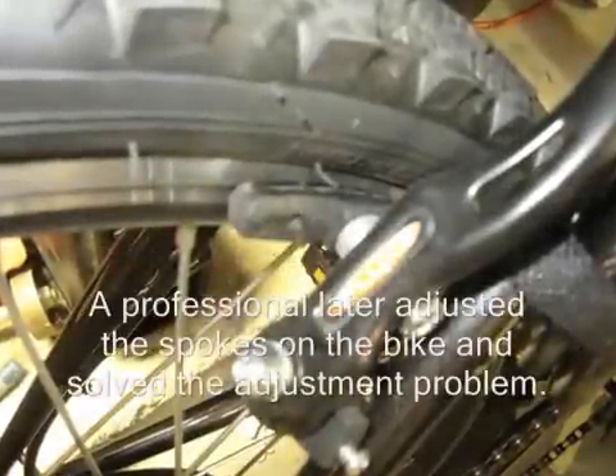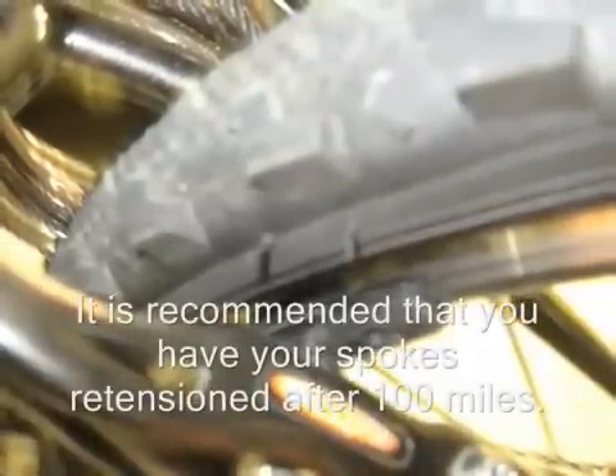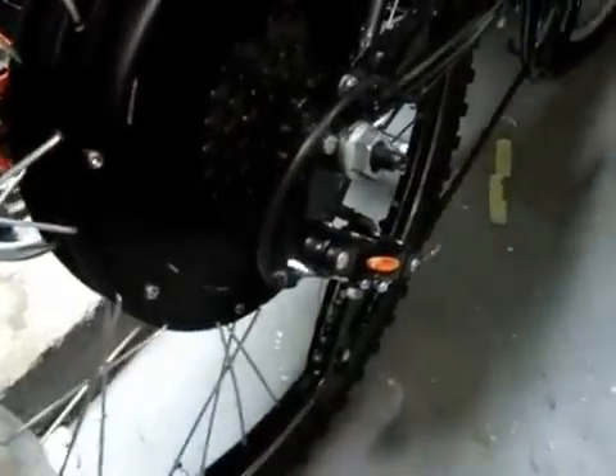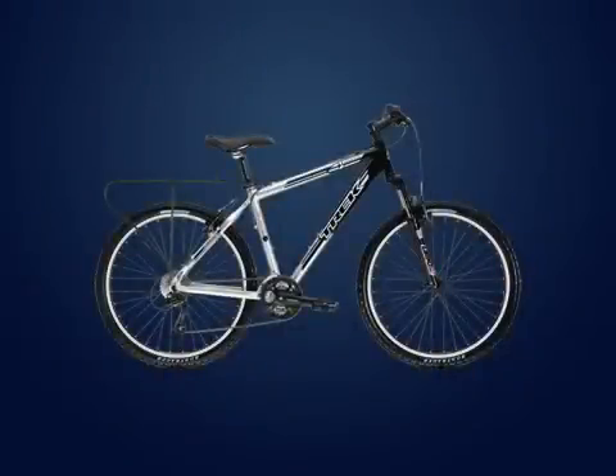With the new tire and rear wheel installed, I also had some adjustments to make. The right brake pad lined up well with the tire, but the left brake pad was crooked, so I had to bend the screw post to make it line up properly. Also, we started with a 7-gear wheel and replaced it with a 6-gear wheel, so we need to adjust the derailleur on the back so the chain won't slide off the final gear. You might even want to take it to a bike shop to have them adjust it so it shifts nicely. You'll also notice you have about 55 pounds of extra weight on the back of the bike now, so the stock kickstand is likely not going to support the weight. Next, install the rear kickstand, which mounts to the rear of the frame and swings down at the rear wheel to better support the bike.